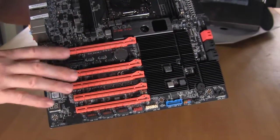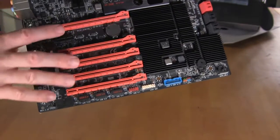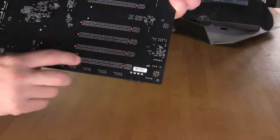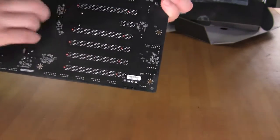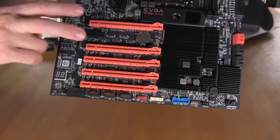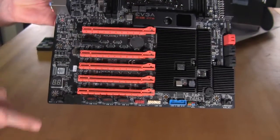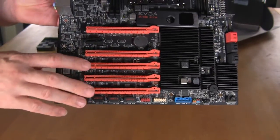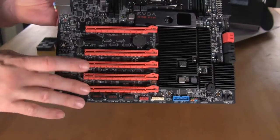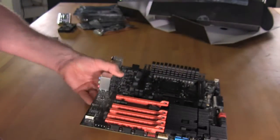We have some pretty good peripherals here. You have five X16 mechanical slots and all of them are pinned out for X16 electrical — you can see that on the back of the board, they're all fully pinned out. However, when you're running SLI, you're not going to get full bandwidth on all of them. These two are both X16 independently, but as soon as you put them in SLI, you're only going to get X8. Then of course this slot will run in X16, or one of these will run in X16, which brings us to what we were talking about with those SLI bridges.